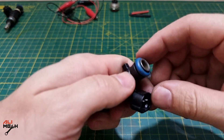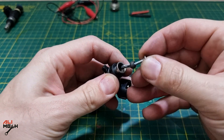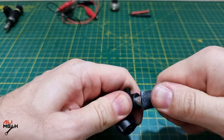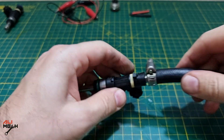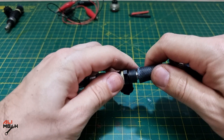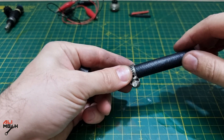And here is the hose adapter. Always remove the O-ring and the filter strainer of the fuel injector that you want to clean before inserting it on the hose adapter. The reason I always use the hose adapter: first, I can use it for cleaning different size fuel injectors, and second, we can use it for cleaning backwards too. Sometimes we have to clean it backward when there are small particles tucked inside.